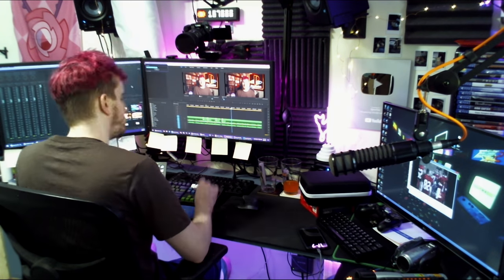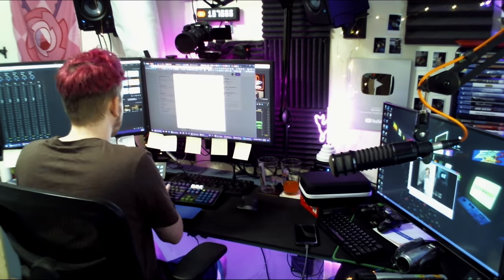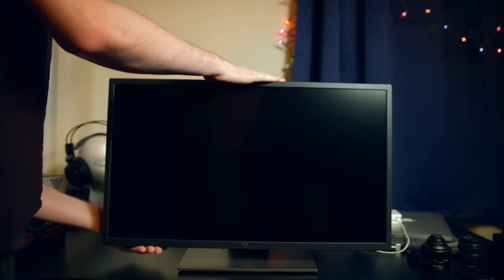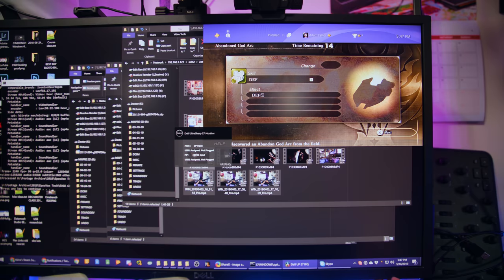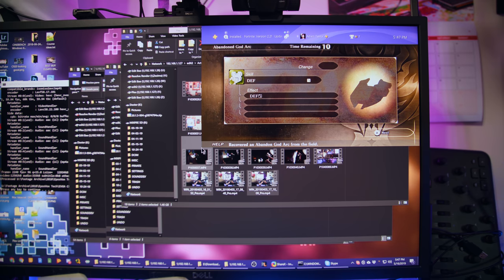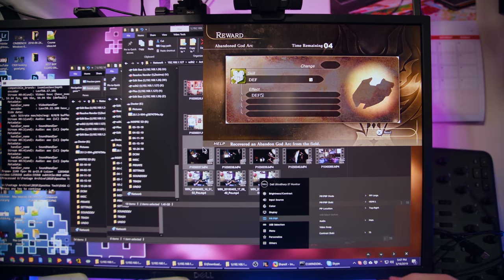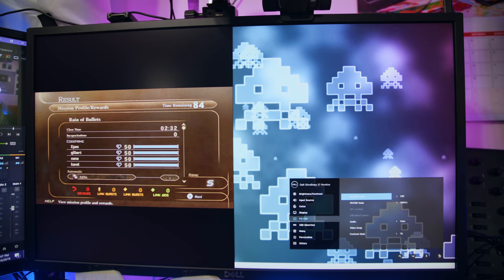This means the monitor is ready for even high-end color-accurate needs for video production and photo editing. For people like myself who rarely get good results when calibrating, it is ready to go out of the box, although pretty much everyone will recommend you calibrate it every few months. The Dell UP2718Q also features picture-in-picture and picture-by-picture modes, so you can view a small window of another input while keeping your main input full screen, or set up side-by-side or 4-way inputs. In picture-by-picture mode, it tells your computer the monitor is half the width for portrait-mode window organization.